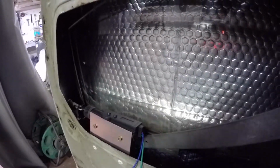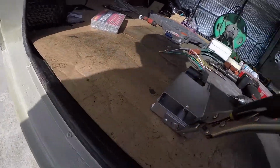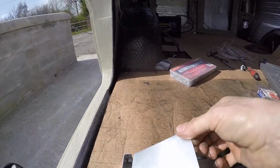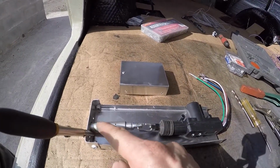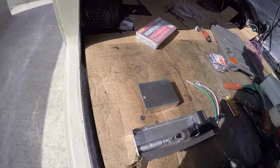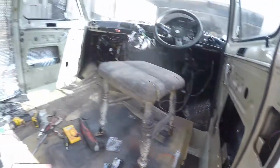And it misses. So on this side lock mechanism, I'm going to have it going down the back of the door here, but I've had to put a spring tensioner on it. Don't know if you can see it in there, a little spring, because I'll just pop this off. Just done it there with a little pop rivet, a bit of metal. Just put some tension on the bolt there because as it's going in, it's bouncing and rebounding back. So if I put a bit of tension on it, it's alright. And it works all good. I tried it on the battery. So I've done that on that one. And I've also done it on the passenger and on the drivers as well. There's a little spring on a rivet around the back there. So it was working alright anyway.